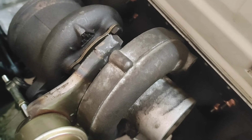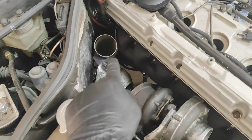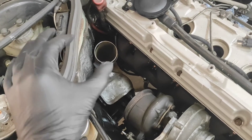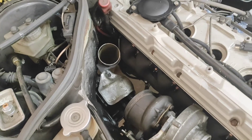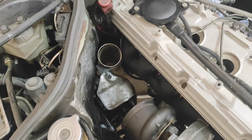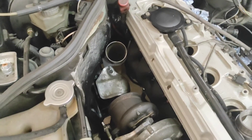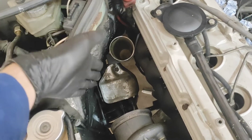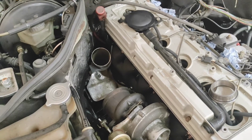I also had to extend out my bracket here, which looks a bit ugly but it's not too bad up close — it's just discolored. I started on making the downpipe. You can see a piece of sponge holding that pipe in position where it's not fouling on anything, with preference being closer to the manifold than to the car wall. The manifold is going to be hot anyway, so I might put some reflective heat shielding tape in that corner — maybe just extend the existing tape further down.